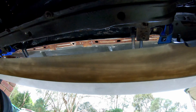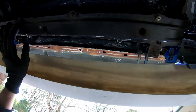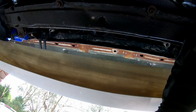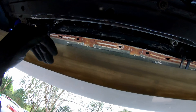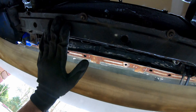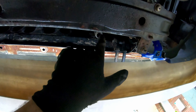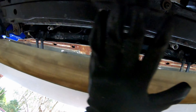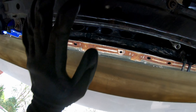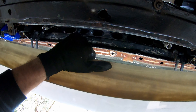I was thinking about fiberglassing some standoffs on here and bolting it on, but I really hate fiberglassing and I think the plate will work just as well. So here we've got the bottom of the radiator support - that's part of the chassis, I can't change that. I want to make a big plate that goes from there to the lip, go under the lip, bolt through it, and that'll make a bit of an undertray - a shield for the junk under here. I've got to make sure the aircon lines aren't in the way, but I can use the bead roller and make it a bit sexy. On track at 200 kilometers per hour down the straight at Phillip Island, I really want to make sure this lip is secure. I think by doing that we're onto something.